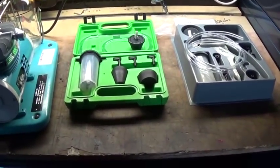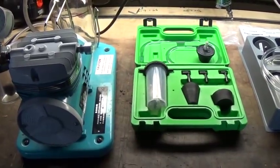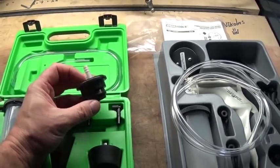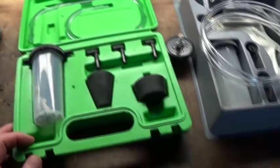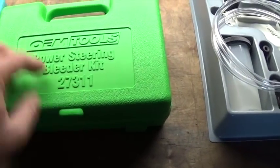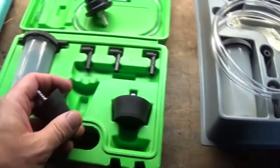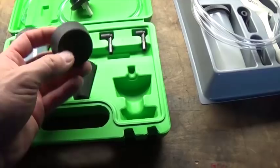It's been a week now and the car is fine — everything is okay. As I mentioned, I made myself an adapter. I got an oil cap for Chevy trucks, drilled a hole through it, and put a plastic adapter on it so I can attach my hose. Then I looked on Amazon and eBay and found this little kit — it's the OEM bleeder kit, part number 27-311. It's $25 and it has two cone adapters. I think for most cars this will work fine.